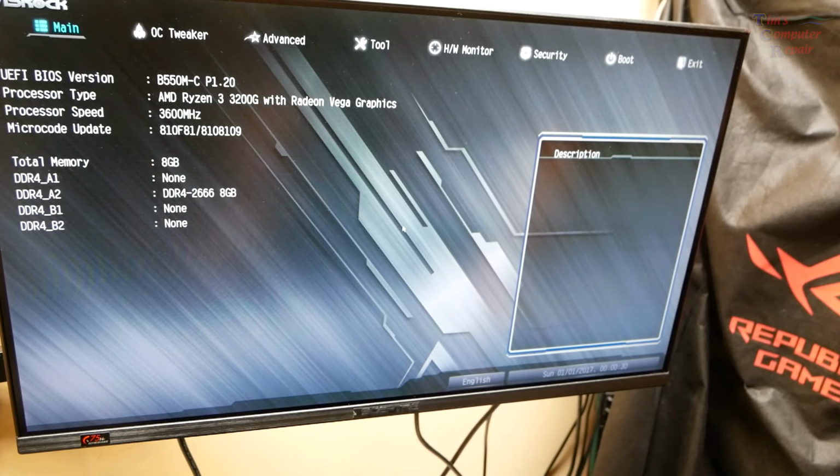So that's it. I think he's lucky that he has a bad processor rather than a bad motherboard, because at the time of this video, again, that ASRock B550M-C is not being sold any longer. If I can replace it with the exact same processor that he had originally, he won't have to worry about reinstalling Windows. He won't have to worry about Windows deactivating. And he can just pick up where he left off. It'd probably cost him less money if we just replace that processor. So that's what I'm going to look up, and then get with him, and we'll get this taken care of for him.